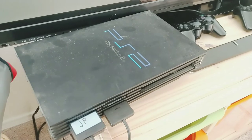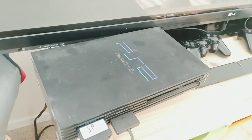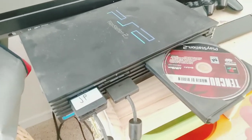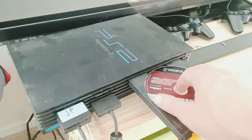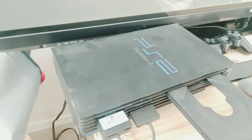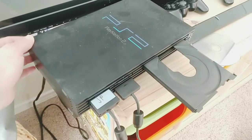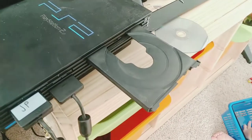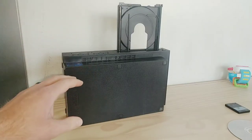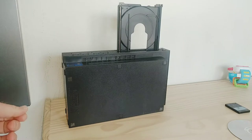So we're going to tear that thing apart. I have a feeling the problem is more than just a dirty lens. What I do is I pop the tray open — the front cover is gone, but whatever. And then while it's open, just shut off the PS2 in the back and then it will just stay like this. I'm going to clean it all out and lubricate the screw gear in there for the laser lens. Let's take it apart.